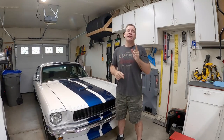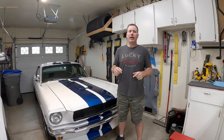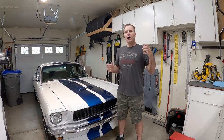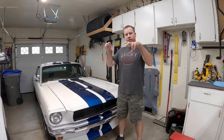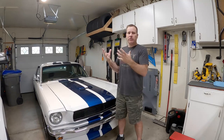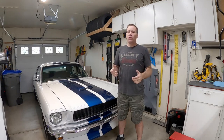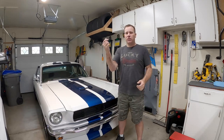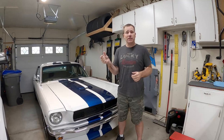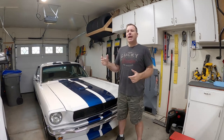What's up guys, my name is Andy and in today's video we're going to replace a part that I broke on my 1966 Mustang in a previous project. On the bottom of the driver's seat there are four bolts that go through the floor and you put nuts on to hold them down in the car. This car is 55 years old and taking those nuts on and off over time just weakened the bolt, and I broke one of those studs in the seat track. You can't replace just that stud — you have to replace the whole seat track. So that's what we're going to do today. Let's get started.